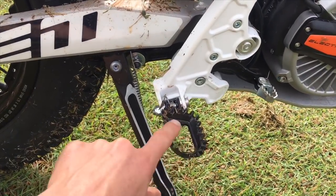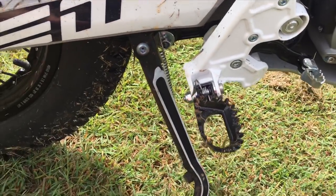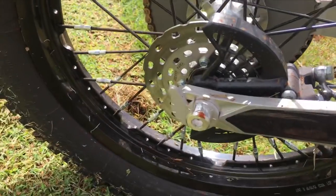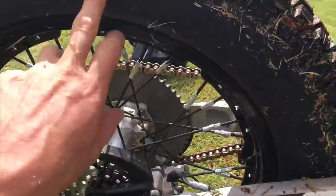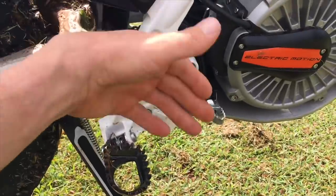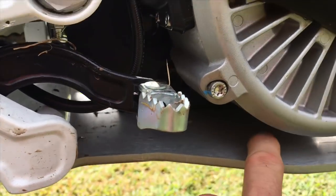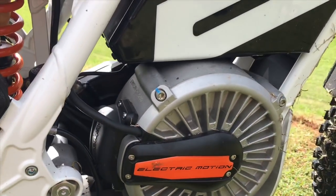Maybe the least impressive detail would be the foot pegs, but even then they're wide enough, adequate, and lightweight. What you can't see on the internet is that this is a cast aluminum swingarm — it looks like tubular steel. Nice little brakes, very powerful small rotors, billet hubs, high-end Michelin competition trials tires, a chromoly frame, and a very legit skid plate — rubber dampened underneath. You can really smash that into stuff and not worry about roaching your motor.